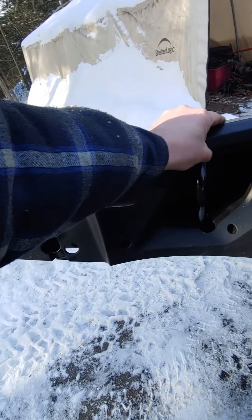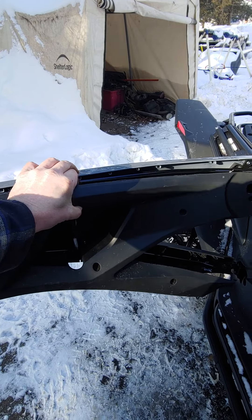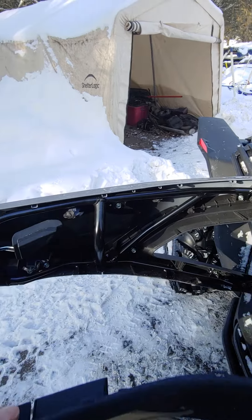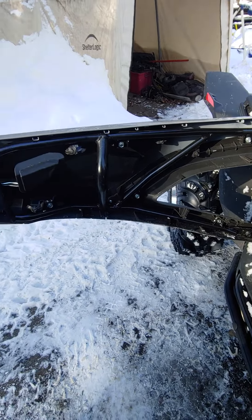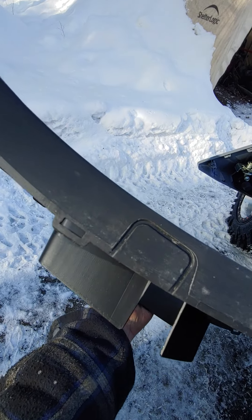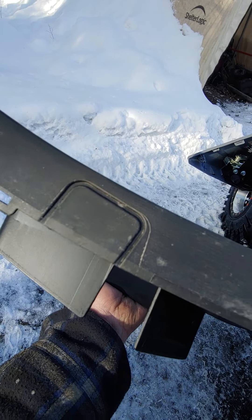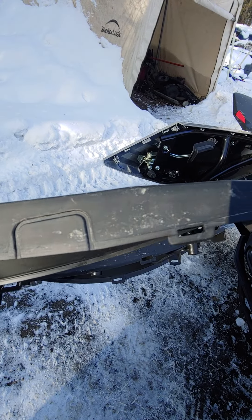You gotta remove all your screws from the inner door panel — it's got clips on it. They pop apart, which reveals the inner structure of the door. At this time, when you get the panel off, you can go ahead and cut out these little cutout squares. This is going to allow the door panel to go over the new hardware.